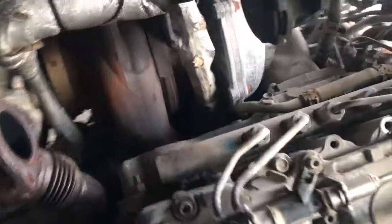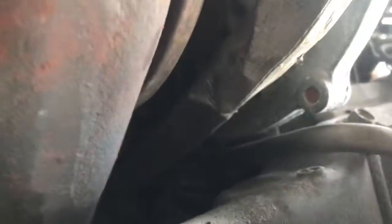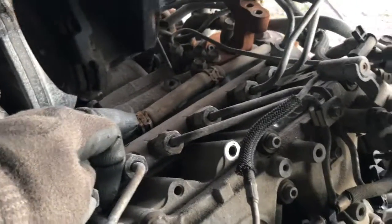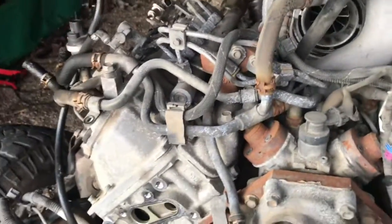Antifreeze-cooled turbo on this thing — I believe that's where that's going. Goes right down into the valley. I'm pretty sure that's where it's going to be getting its coolant. We'll find out once we get the Y-bridge out, but for now we'll just pull those brackets off. Pull the hose off right here, and then that'll be out of the way. If we need to go further and get it out of the way completely, we can do that later, but that piece and that hose won't be in the way for pulling the intake manifold off.